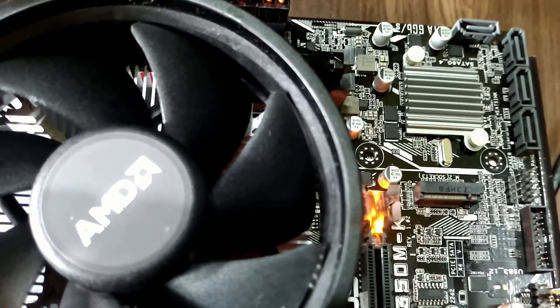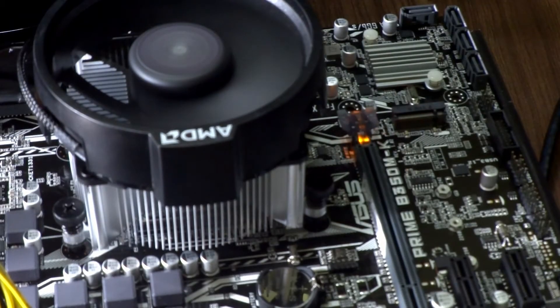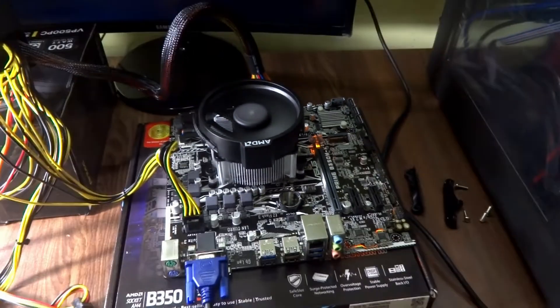Let's power on — you can see the PCIe slot is powered on. Let's power on the system with a screwdriver. It's on, fans are moving. Since my GPU hasn't been delivered yet I know it won't post without a graphics card, but my monitor was showing some activity — it went blue screen then blank — so it is receiving a signal, which is a good sign.